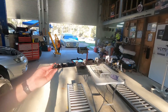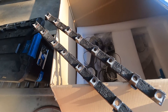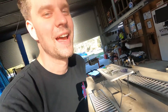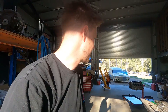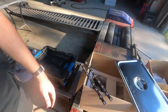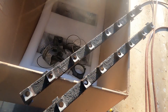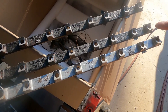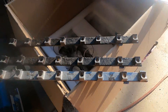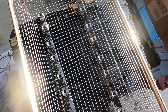The last test with this unit: we have these rocker rails from a car that was clearly not well maintained — lots of moisture in the oil, absolutely caked in carbon. These have been soaked in caustic degreaser, blasted with a gurney, left outside — we tried everything and gave up on them. Now chucking them in the sonic cleaner for 20 minutes, up to full temp. For reference, the ones we just cleaned are what they should look like.